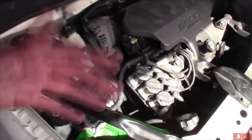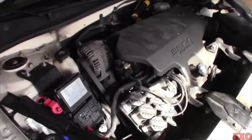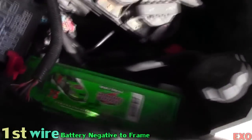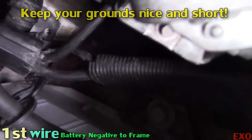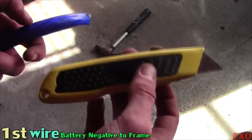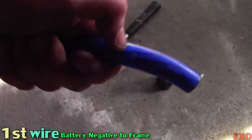We'll be putting a second battery up back and grounding it to the frame because everything will have a nice secure connection to it. We're gonna start the upgrade with this short ground here, which is going to be connected right to the frame as close as you possibly can to the negative battery terminal itself. Remember, the shorter the ground wire the better. For stripping the zero gauge, I just use a utility blade, go around the whole thing, and it pops right off real easy.